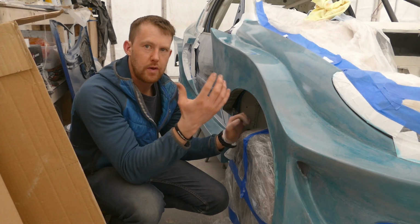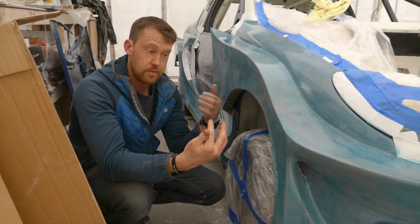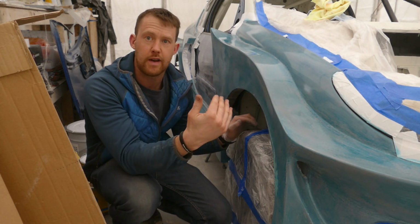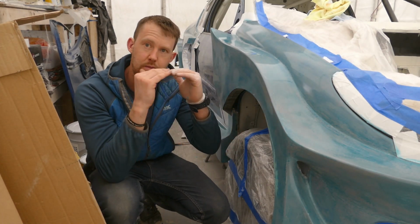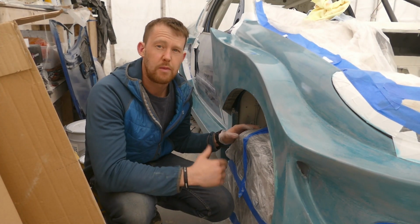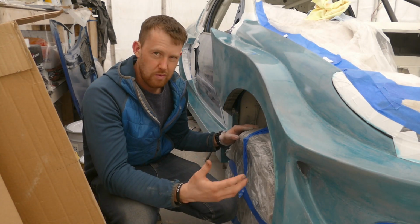The first method of doing individual panels, I also have the issue of not knowing exactly where I want the panel to start and end, and once I have the panels off the car, there'd be a lot of work to get it all aligned. The second method could work quite well, because if I have a millimeter gap where the panels are cut and effectively where the joins will be, with that closer tolerance, I could actually take up some gap and maybe do a slight overlap or a tidy butt up with the panels. So I think at the moment I'm going for option 2. It'll be a lot easier to do it all at once and then just hope there's not too much damage on the car in case I have to pull another mould, but I think it's probably the safest way.